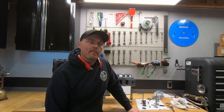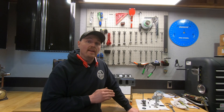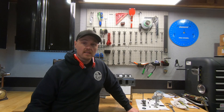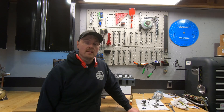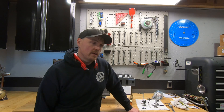Overall I'm fairly happy with the Speedmaster heads. I think it's a solid casting. The moral of the story is: when you're buying new heads, especially assembled, take them apart - or have someone that knows what they're doing take them apart - and take a look at them, because it's amazing what little things you'll find nowadays. Sometimes even on really high-end brand name heads you can end up with some pretty bad valve jobs or things getting missed. It's just kind of the way it is. I know some of you are going to be upset we didn't go with the Edelbrocks, but that's just the way it goes when you're dealing with people and their budgets. Let me know if you have any questions, comment below, and don't forget to hit that like and subscribe button. Thanks guys.